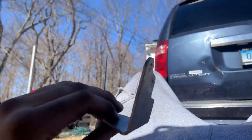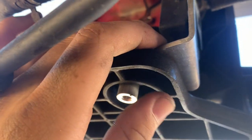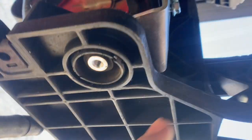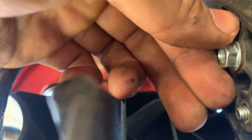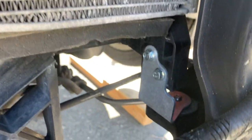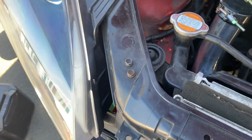Take the bracket and maneuver it in under the passenger side headlight — it just falls right in there. You're going to have a rubber grommet in there; put it in now or after, either way. Line it up right where the old one was, then put the bolts right through. I just put the rubber piece in. The bolts go right through, and then on the back side you just put the nut on. You need two hands to hold up the radiator, but you get it. Now tighten up all the bolts. Tighten up here and up there, and go back to the intercooler install.